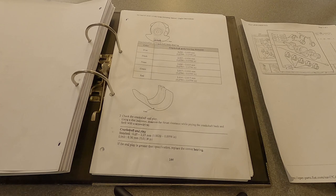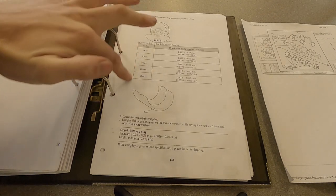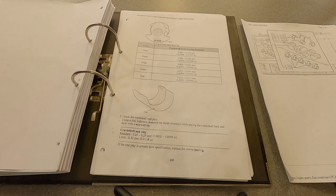You'll need to look at what's available on the market as well. Get the OEM bearing sizes, but you'll also find that some aftermarket manufacturers might give you more variants. Just to clarify — this is what I was on about by multiple bearing sizes: multiple standard bearings available, not just the undersized for polished cranks.